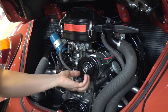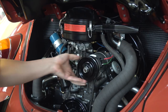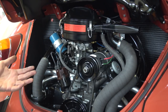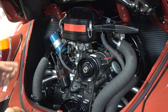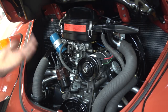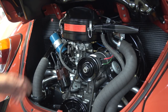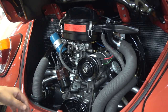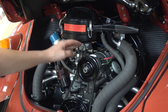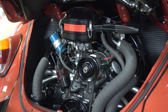What was happening last time is I was turning this pulley and the belt was staying stationary while the pulley was spinning — that slipping action is not good. It was not cooling the motor efficiently. We did a big bore on this, so it's a 1641, which naturally runs a little hotter than a normal 1600. I need as much cooling as I can get, and I was even noticing a lack of power over time — when these motors get hot, they lose power. So the tip for today: paint your pulleys, don't powder coat them. Make sure you have the right pulley for your year bug, and make sure all your tin work is set up correctly to keep your motor running efficiently.